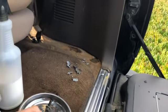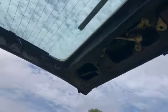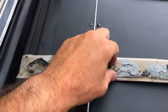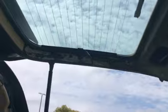First thing on this rear hatch — it's pretty simple. There are two screws that come off, then you pull off the little plastic trim. The rest of the plastic trim is held on by clips, so it's really easy to take off. You can see how dirty and dusty it is. Now I'm taking apart these plastic trim pieces, and I'm already noticing some prior ghetto repair — looks like somebody put some kind of caulking or adhesive to make it stay up there, which obviously isn't right.